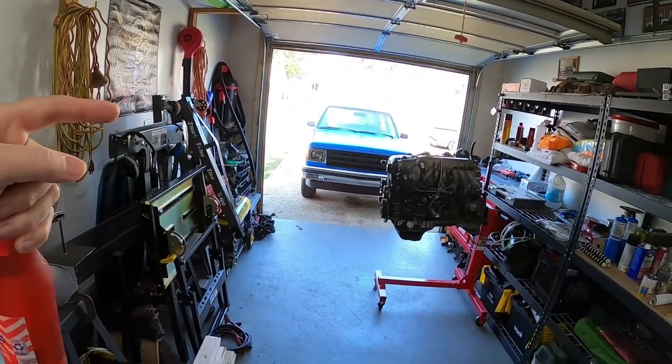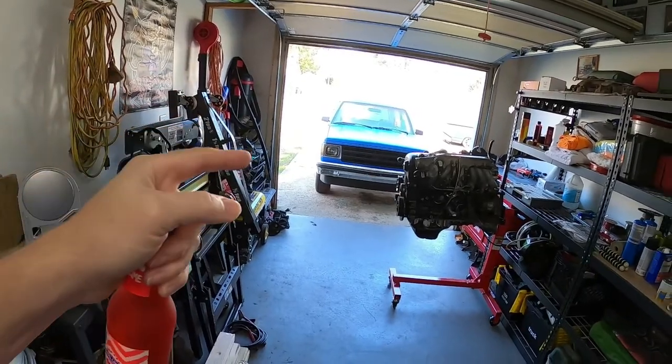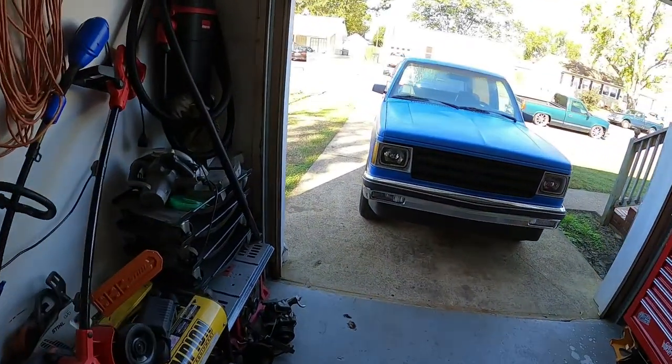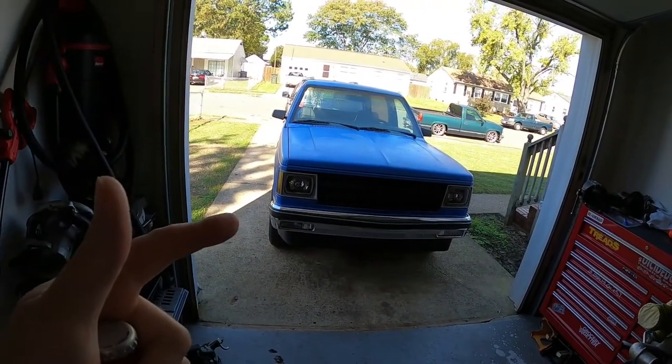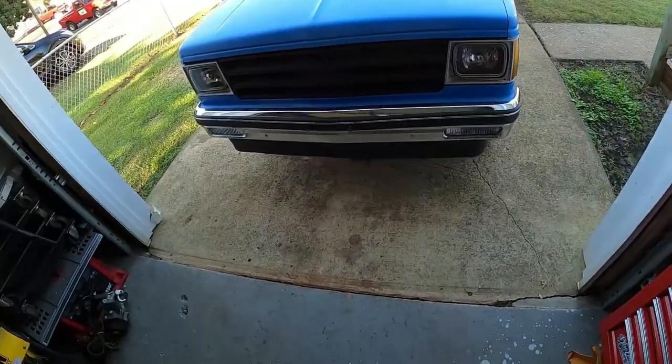We are going to try to get everything off of this. I'm going to leave the hood on for a little while just to keep the motor covered, but fenders, grille, radiator — everything off of this is what we're going to try to get done in the next day or two. I want to have it stripped down to basically the hood, the motor, and the frame. All the front of this has got to come off. It's just going to be a lot of unbolting. I have bags and a Sharpie to put everything in because this is going to be a lot of bolts.